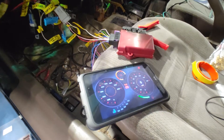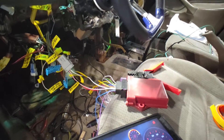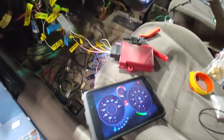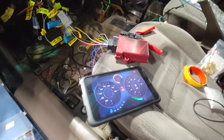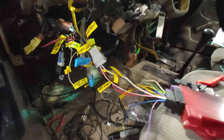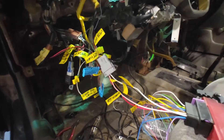We're running a standalone ECU, so your analog inputs and other sensors on the powertrain are all going to stream through a CAN bus to RealDash. But those turn signal indicators and high beam indicators aren't going to run through the ECU, so we had to come up with a different solution — DashBox. I just got done pinning about three circuits and found a connection in the under-dash fuse box.